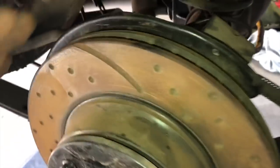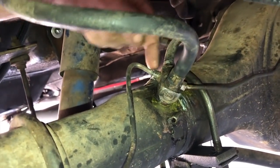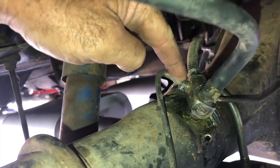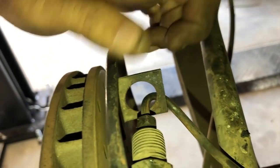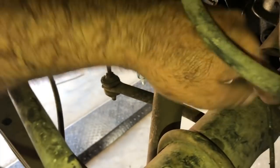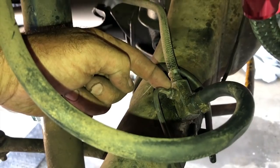I don't know if you can see, but I'll see if I can give you an idea. I got this line off on this side, and so I can thread MIG welding wire up through here, around this side. But this one, I've heated it, I've WD'd it, and used a tube spanner and stripped the ass out of it, so it's frigged. And this guy, I've stripped it as well, so I can't undo that line at all. So if the G clamp doesn't work, we are cutting it and rebuilding this line. Probably have to replace that because I can't get that fitting out either.